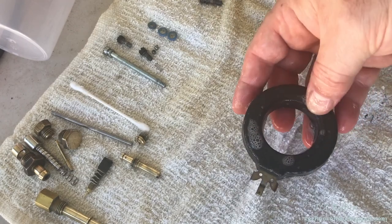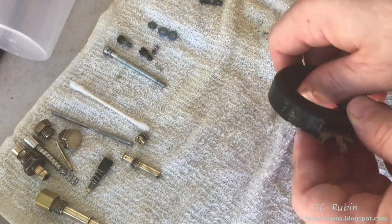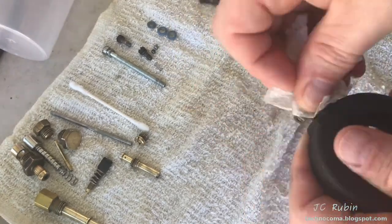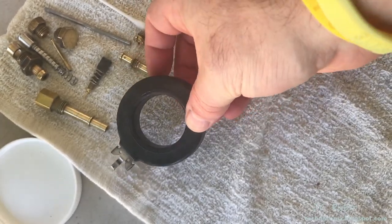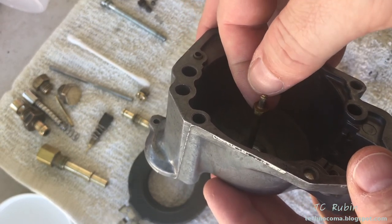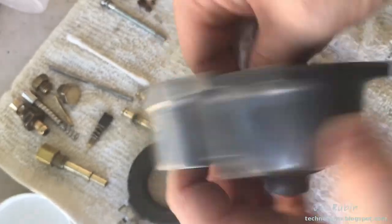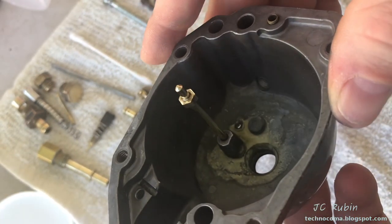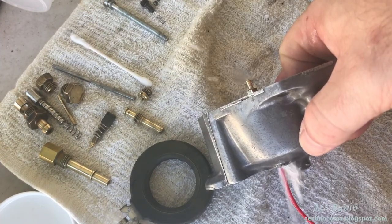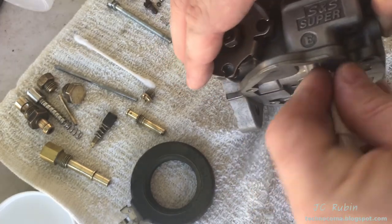Using mild degreaser, I'm going to see if I can clean up the float — I don't want to damage it, just get the crud off. It's getting slimy so I think it is coming off. I'll hit this part with some metal polish gently, give it a rinse, let it air dry — that part is done. I'm going to clean this right quick — this is the nozzle for the accelerator pump. We can see the outside of the nozzle is now cleaned up; the inside will be cleaned when this whole thing goes in the tank. I still want to spray it through with some carb cleaner. Good pattern — everything seems fine.